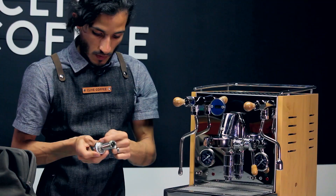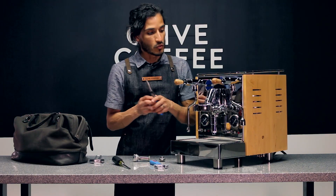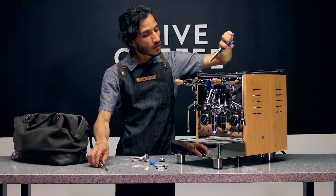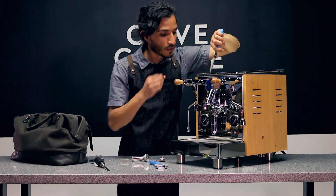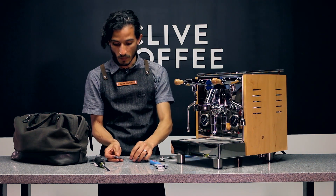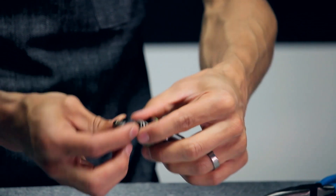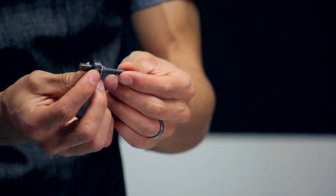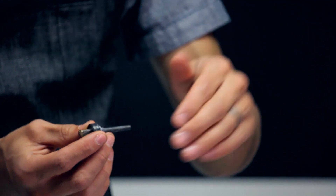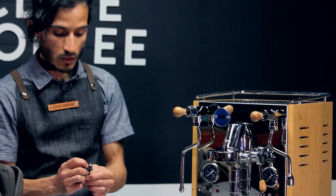This mushroom piece has a white Teflon gasket. You might want to use your pliers to grab your spring and then finally the pin. The gasket at the bottom of your mushroom cap — this entire piece — is really the heart of your E61 group head. It's the one point that closes off that top water chamber and the rest of the group head when water is flowing to the group. Most leaking would be due to this seal not closing up effectively.